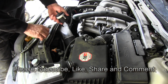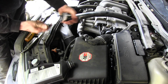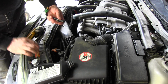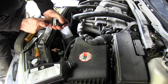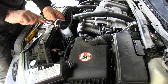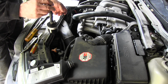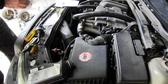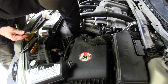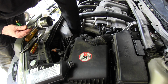So, flow down. You see that? Alright, hose clamp is in the way. Put your hose clamp on there. Make sure the hose clamp is behind the flare. And we'll slide this down in. This is the hard part, and I can't put this on camera. Got to go down in between all these hoses and stuff. Find the place where I cut the line and slide it on there. And make sure that you put your hose clamp on first on the hose.